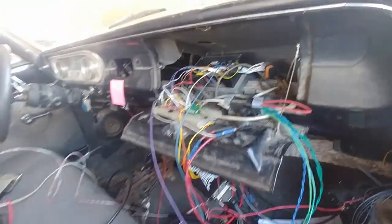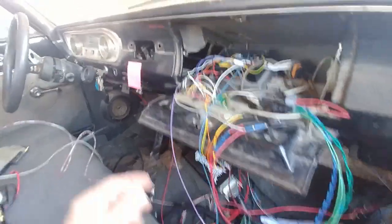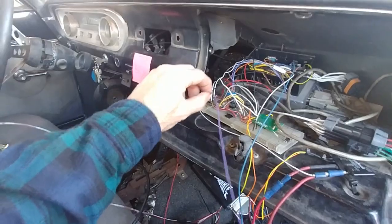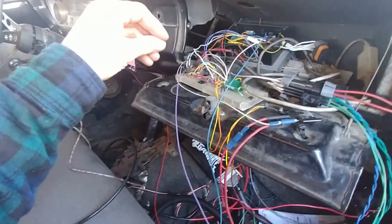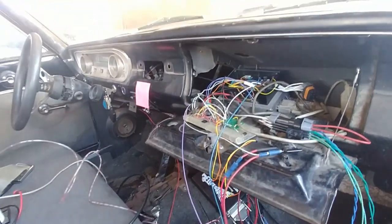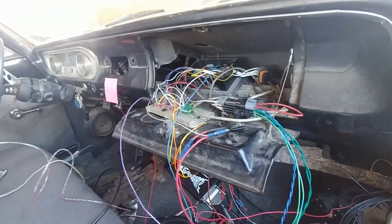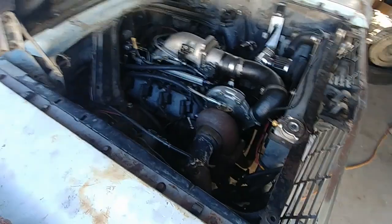Out of the spaghetti wire it connects together to my WeatherPack connectors and then off to the transmission down below. Really the only other connector to make all this work is vehicle speed, which I'm using PT4 plugged into my Teensy board. I was also measuring front and rear wheel speed. When it comes down to it I'll swap all these around, might redo the wiring back to the sensors to make it a little more robust, then splice it into the MegaSquirt harness power.